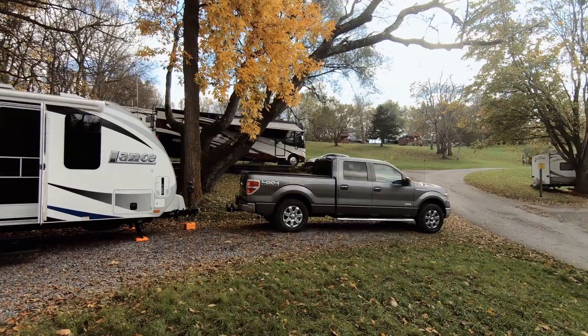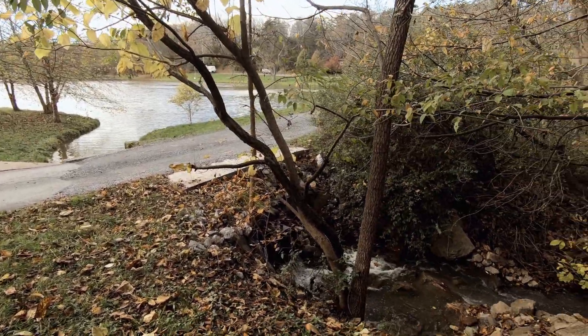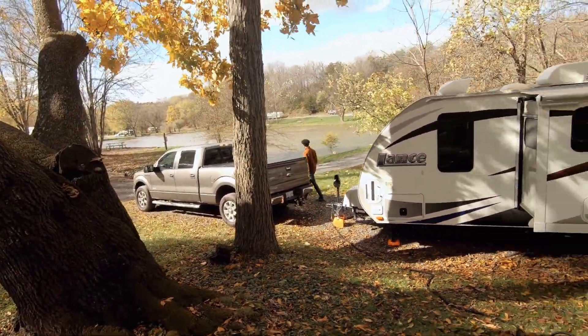So just to sum up what just happened, we had a little bit of a tough time leveling it because the site is kind of unleveled, but we figured it out. We disconnected the weight distribution bars on level ground, which made it very easy to take off because this area was pretty unleveled and I knew I was going to have a hard time. From previous experience, unleveled sites are hard to remove those bars. So we took them off at a level area, backed it in, and then disconnected it from the truck. That was way easier.